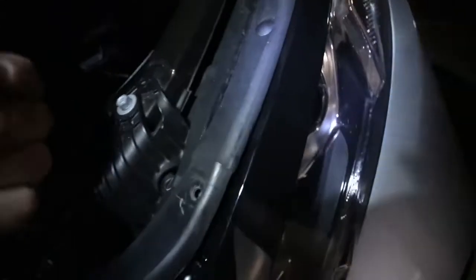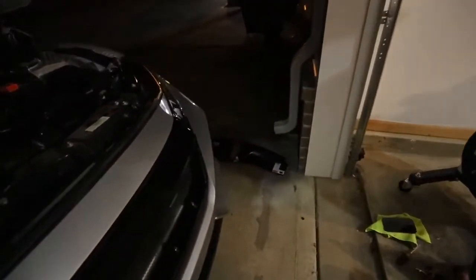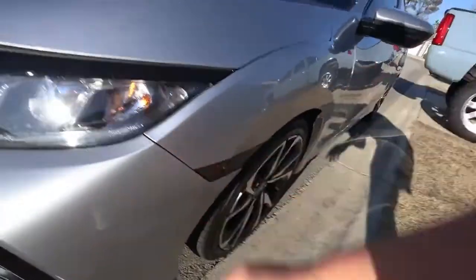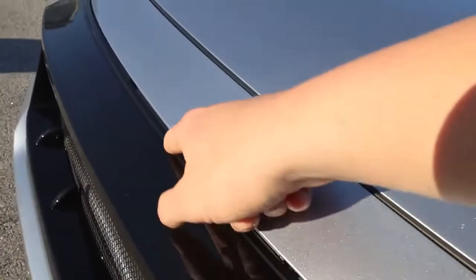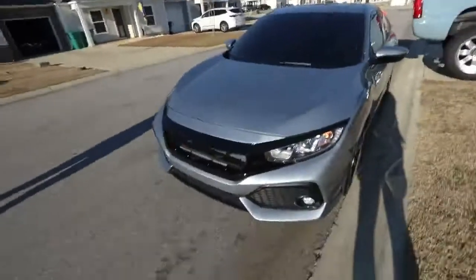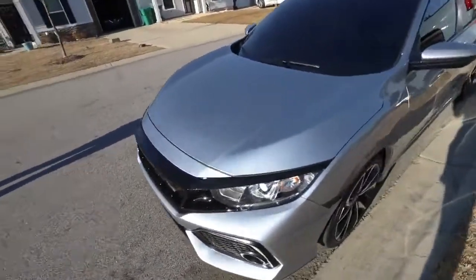She's looking good. Let's get these last little pieces in — snap these headlight ones in, then put the other weather strip on and the splash guard. Huge shout out to American Modified for sending me this grill — really appreciate it. The install is really simple, probably took about an hour. The biggest trick is just getting all those push tabs off on the bottom of the bumper. You don't really have to remove the marker lights — you can just pull the bumper out around them. My only complaint is about these little push tabs where I had to zip tie it to make sure it's secured because it didn't really click in like the OEM grill did. But other than that, no complaints — it looks good, has a lot more airflow, and looks pretty sporty. Not bad for the price — check them out, I have them linked in the description.